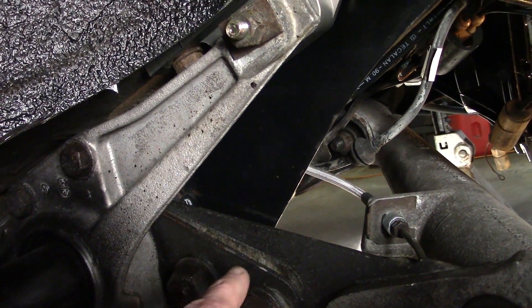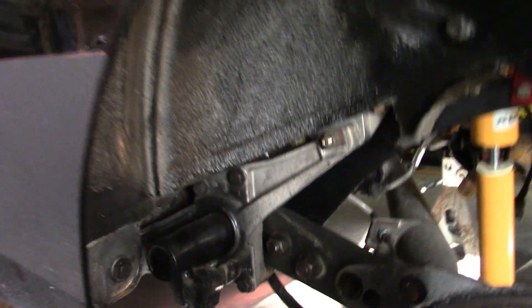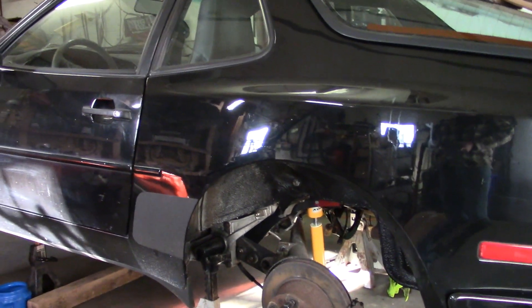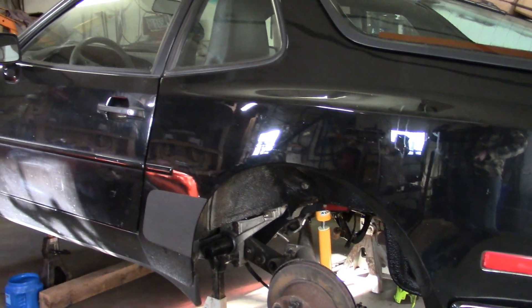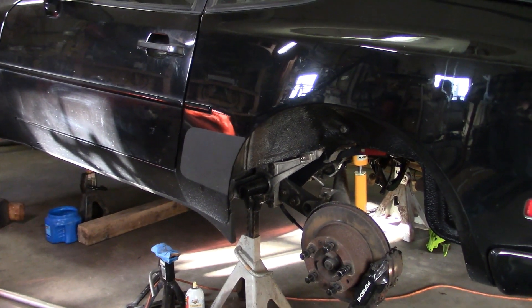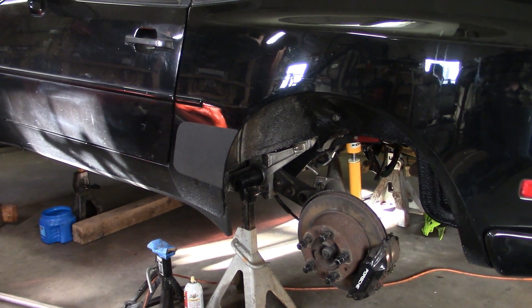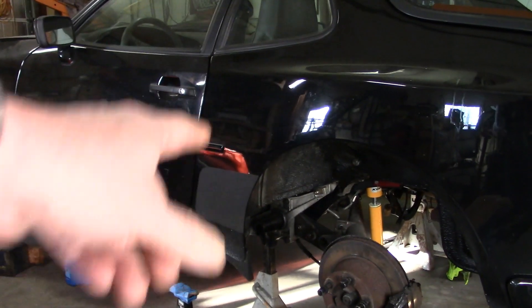To make sure we got the indexing exactly the same as it was when we pulled it out. Now, on the torsion bar it's got splines at either end — one end has 44 splines and I think the other end has 40 splines — so basically you can put them in different ways and attach the spring plate on in different ways.